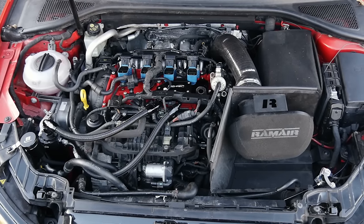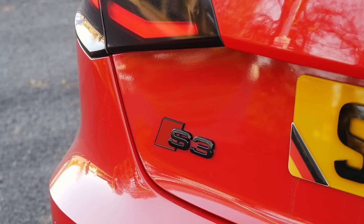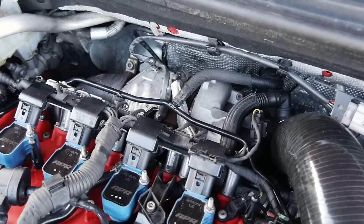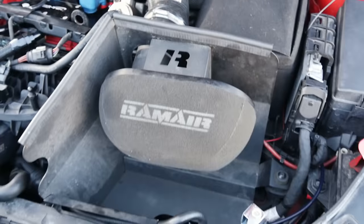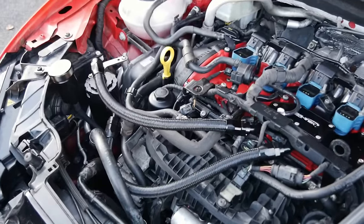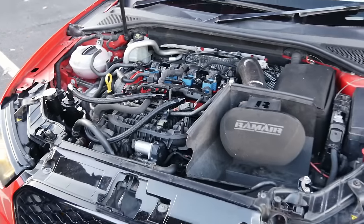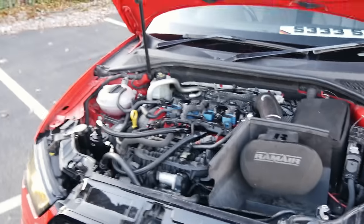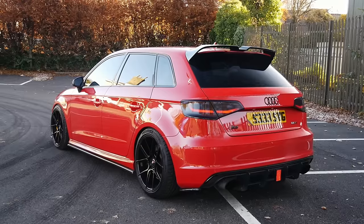Without meth it comes down to 585, and low boost is 525. So there are switchable maps, which is pretty cool. Turbo-wise, we've got a Venom 550 turbo mated to a ram air intake with the turbo muffler delete and turbo elbow. There's a catch can from CVP — custom parts. Intercooler-wise, we've got a Racingline intercooler, with bigger boost pipes as well.